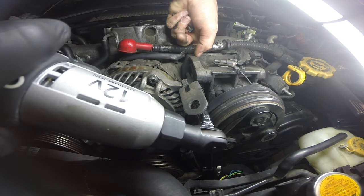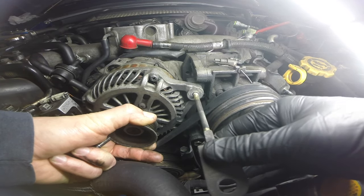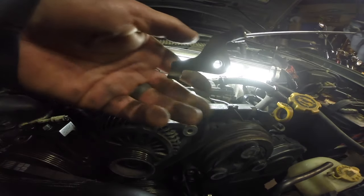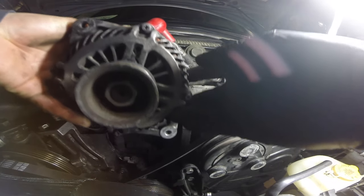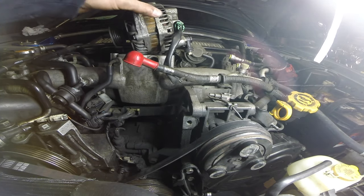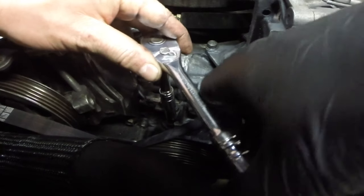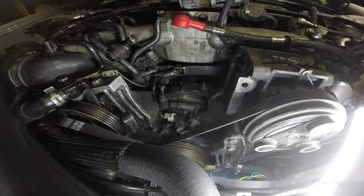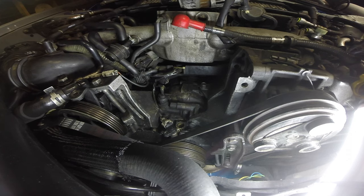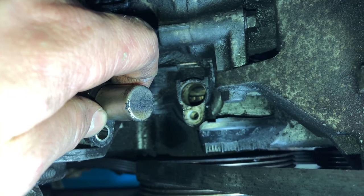There's a nut on that side too. With a little persuasion we'll get it off. I'm just going to let this alternator chill up here and be careful. Here goes nothing — it's a 10-millimeter bolt, so let's break it free and carefully take this off and see what this sensor looks like. That's all it is — just this little thing. It's a little dirty; maybe if I just clean that off we'd have a serviceable crankshaft positioning sensor.